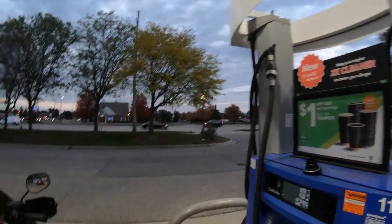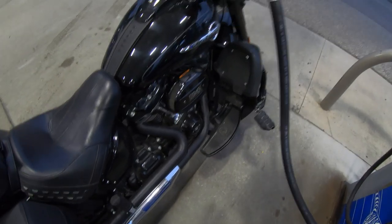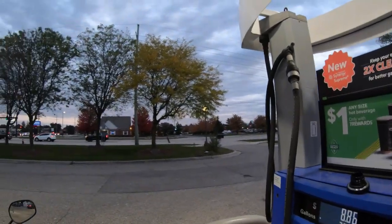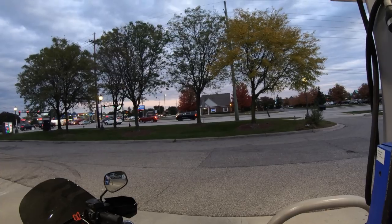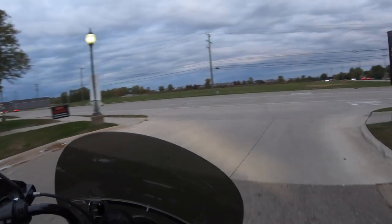But the reason those high pressure oil pumps aren't doing anything is because you can pump your oil all you want into your system, but like I said, you're not going to accomplish anything if you're not getting oil back into it. And the reason the whole sumping issue is occurring is not only just because of that throwing and the centrifugal force, it's because there's not really a vent, but there is a solution. And like I said before, T-Man's solution to it is ripping apart your whole brand new Milwaukee 8 and putting in a little plate,